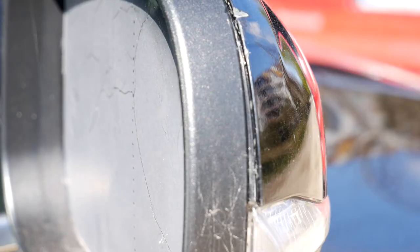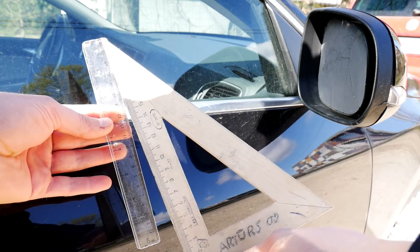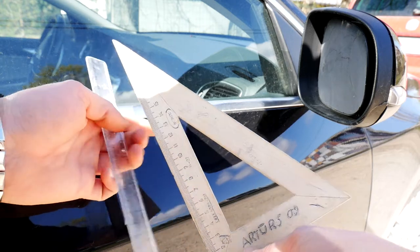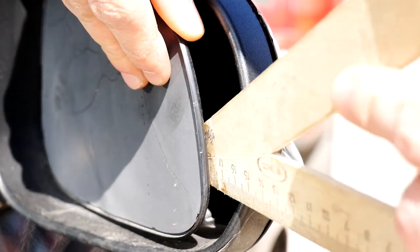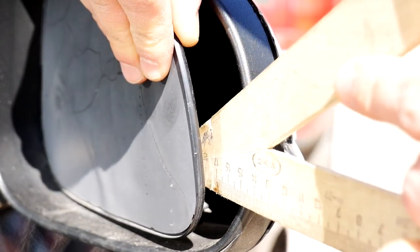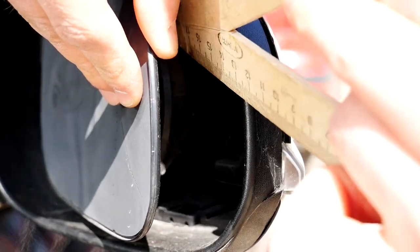Before trying to remove the mirror, tilt it in a way that you can put a stick behind the mirror glass, and with that stick you can remove it. It's better to use a wooden or plastic stick — they are softer and will less likely damage other parts. Place your chosen stick behind the glass and carefully, with feeling, try to push the damaged side mirror off its fasteners, but do it carefully to avoid damaging the adjustment mechanism because it's all made of plastic.